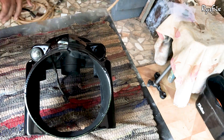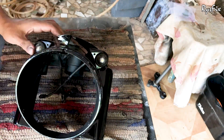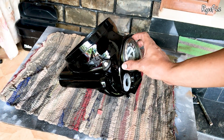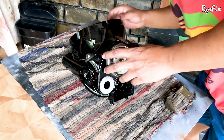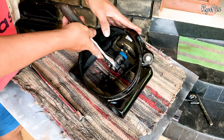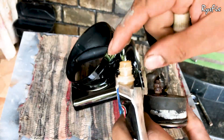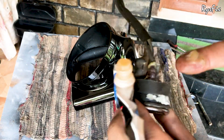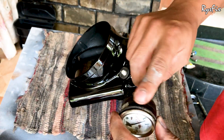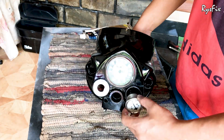I'm done painting the casing, so now I'll start putting everything back. First, put the parking lights in position. Then slide the speedometer back in carefully — it should not touch the paint, otherwise the paint can chip off. Put back the plate that holds the speedometer and then the nut. For the amp meter, I've already placed the rubber packing on top of the meter; put some grease on the amp meter connections, on the rubber packing, and on the slot where the meter slides in.